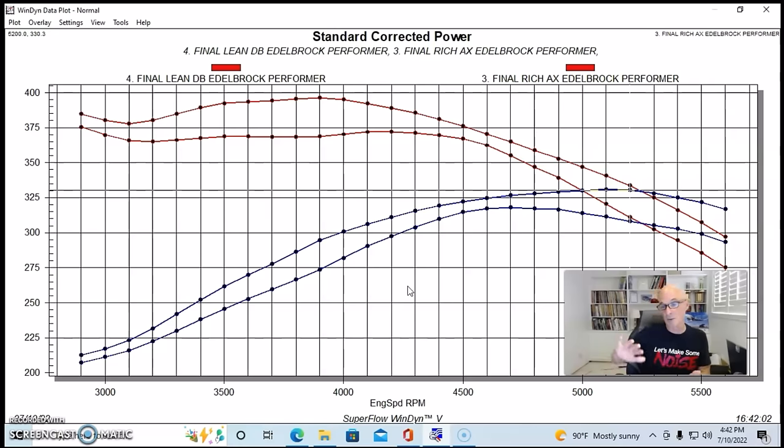So this was with about 6.5 to 7 quarts of oil. This thing wanted to run more oil. We started off with like 5 or 5.5 and then just started adding it, like I said, because we were kind of chasing. You could see here, even after 4,700, we see a big drop in oil pressure. I mean, it looks like a big drop. It's about 10 pounds. We still had over 87 pounds from the start, and it dropped down to 77, which at 5,000 RPM is more than enough oil pressure still. I just don't like to see that kind of drop.